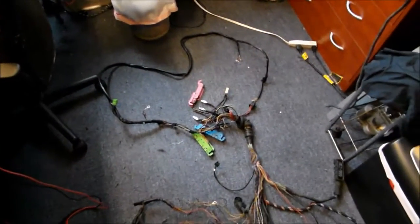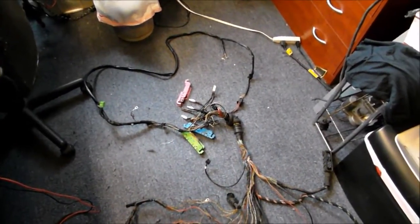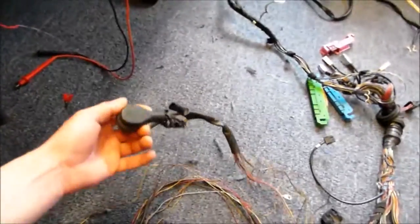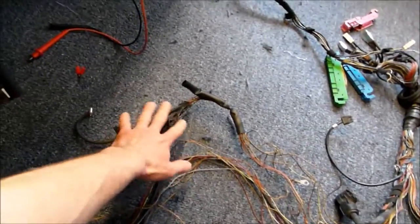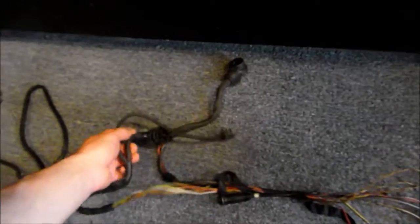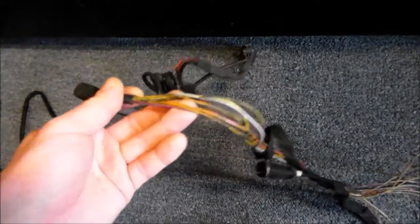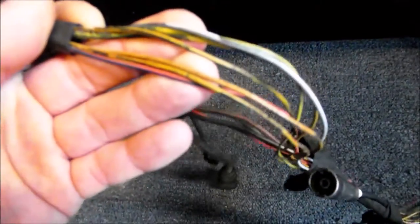The problem here is the mass airflow sensor wires. The mass airflow sensor wires are here — here's one of them right here. This is mass airflow connector number one. As you can see, somebody tried to patch them up. The second one back here also has cracked wires. If you look closely, they're not in the greatest shape.